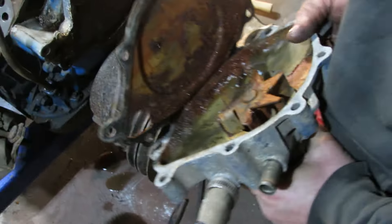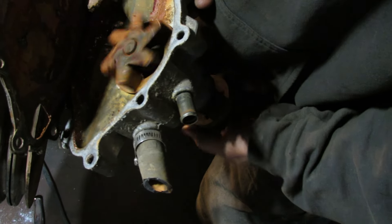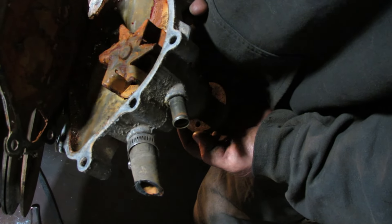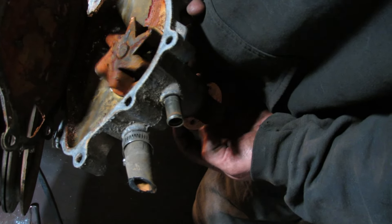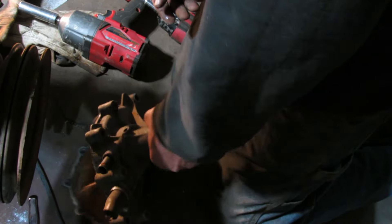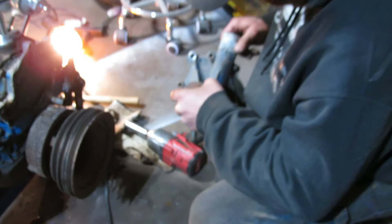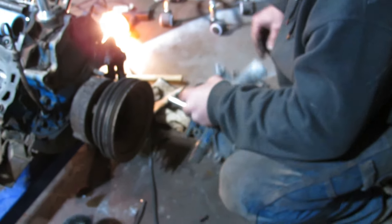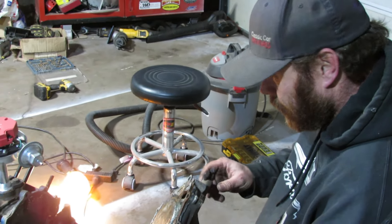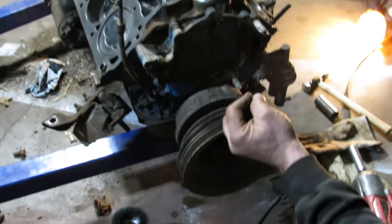So how do you tell which direction the water pump is moving water? If it spins this way, is it moving water this way? Camera person suggests the other way. Yeah — that way, the way the paddles go. So this was the right water pump, right direction. Now I've got a number to go off of. That would have leaked eventually and just caused problems later on. That gasket is so brittle.